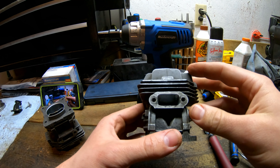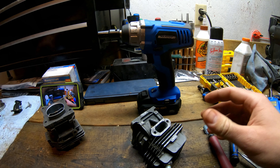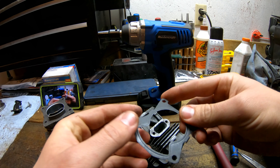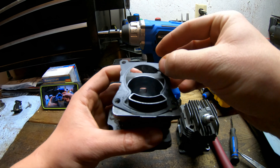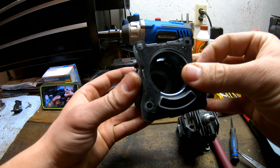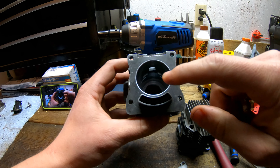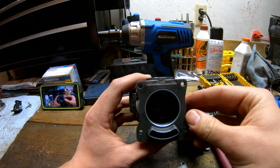This one's not super nice because it's a really fine grit sandpaper and you'd have to work your way up from a smaller grit to a higher grit. But anyway, that's the trick — that's what I did to the 201; it's a lot smoother than this. I never even took any off with the carbide bit. As far as the gasket delete: inside your 201 you're going to end up with a more metal-style gasket — it doesn't really have a soft coating on it. It's got these tabs on the side and it just slips over, and then your cylinder goes on top. What will happen is if you take this off and bolt it down, the piston will actually hit the squish band.